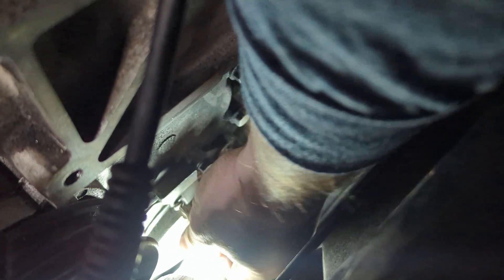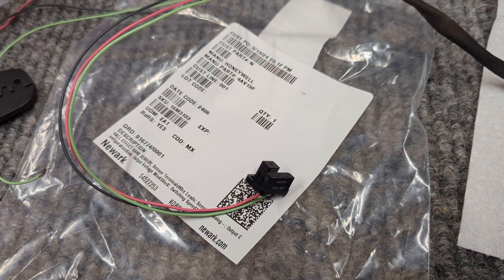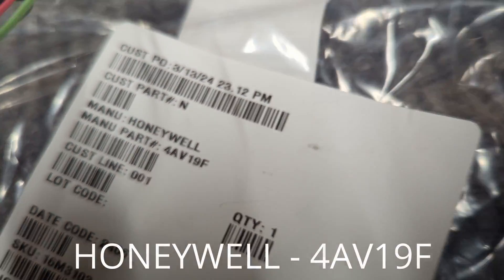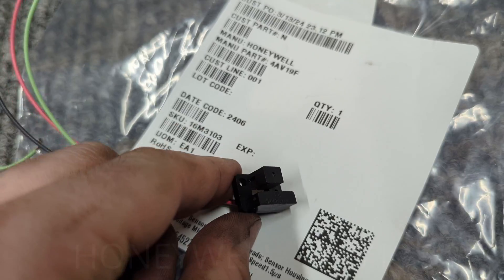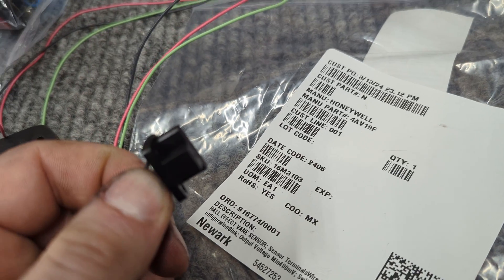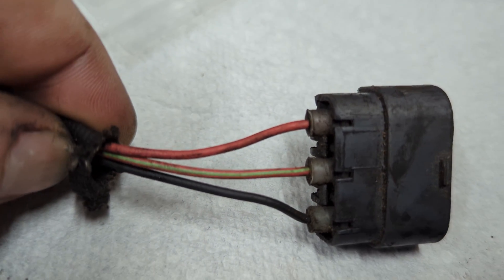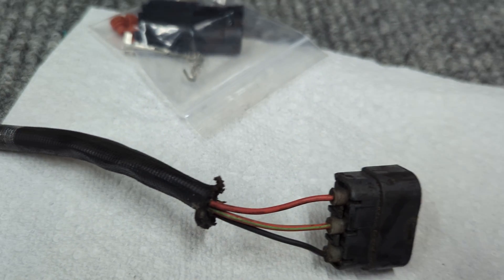Got it — like nothing. So what I have ordered from Newark — Newark is the actual Honeywell part from what I'm told. There's the part number. This is a crank position sensor that's going to work in this '92 Saab 900 base model. These are for cars that don't have the distributor-based pickup in them. So it's three wires: black, red, and green. The original sensor uses a black, a red, and a green-red stripe.